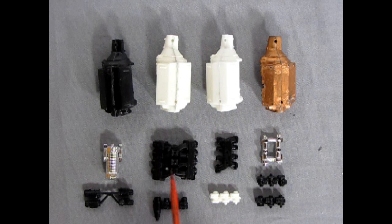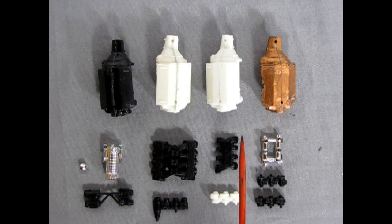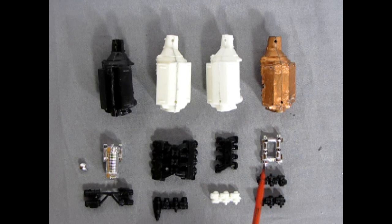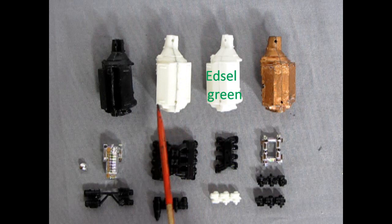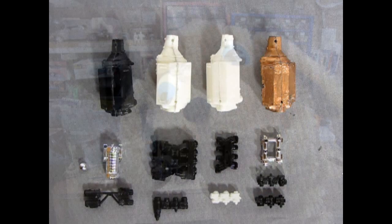What we have here is the Latham blower with side-draft carburetors, then a setup with tri-carbs using little square air cleaners, then our six-pack version as well. I'll build one each of these motors. The copper one will be painted copper to represent the Lincoln Continental engine, the black one can represent the Mercury engine — those were the colors they came in. And then either of the others can be an Edsel, so we'll have an M, an E, and an L motor — Mercury, Edsel, Lincoln.